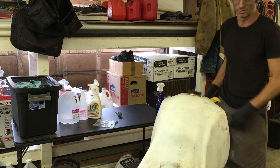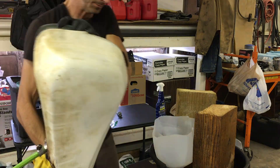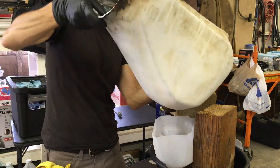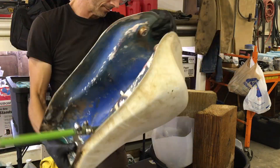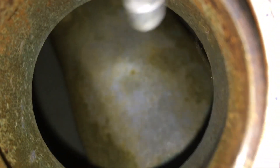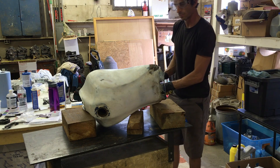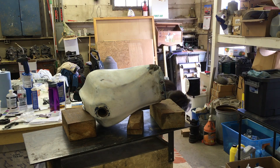Let's get the cap off — it is breathing a little bit. This stuff is really difficult to pour out because of the filler neck. Let's take a quick look in the tank and see how we did after the acetone — not bad, good enough to line this sucker. Let's blow some air through there to make sure there are no more acetone fumes. We're golden — sorry there's no fireball — but that's the safest way to do it. Now I'm ready to line this tank.